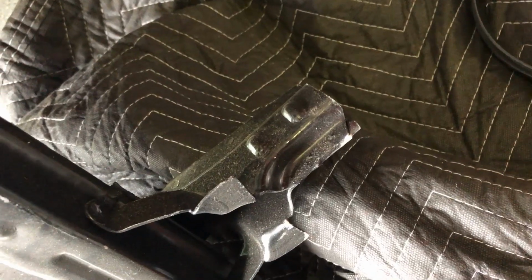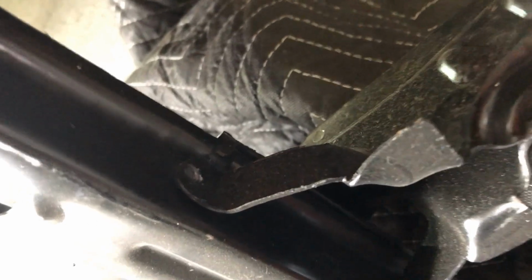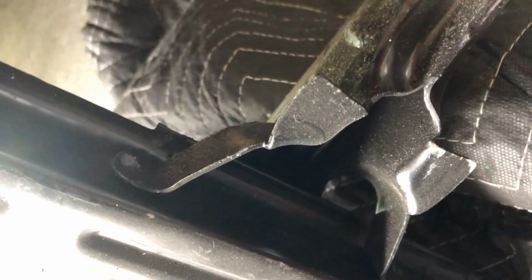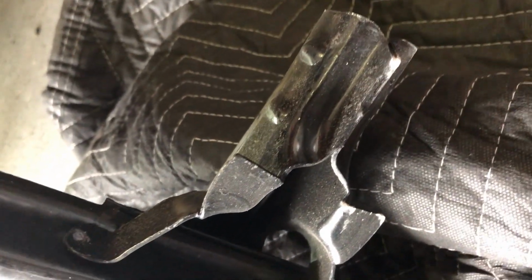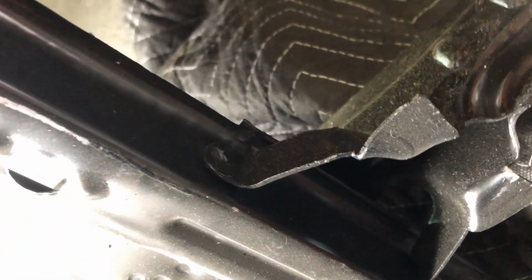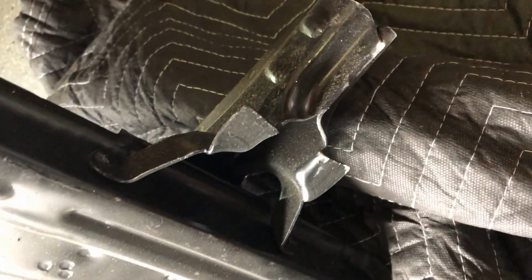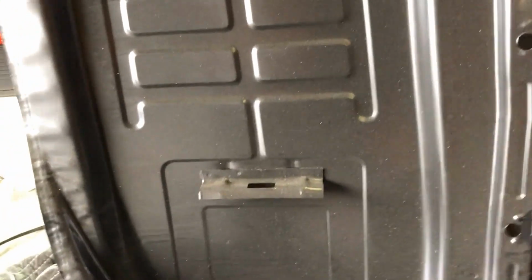As I'm removing the hardware, I'm starting to see that this replacement pan just has this one press weld there. I might have to hit that up all the way around. I just do not want to be lifting this car by this original OEM method and having this press weld just fail during a lift, especially after the car is fixed and bodywork's being done. I'd hate for it to just fall and crush some fiberglass or metal work. So that's where I'm at on this.